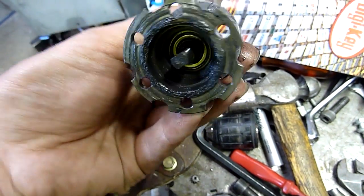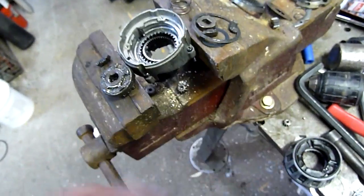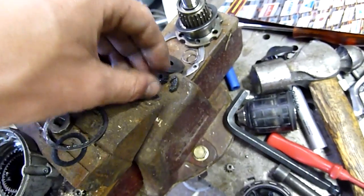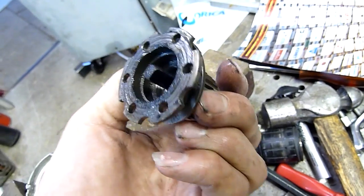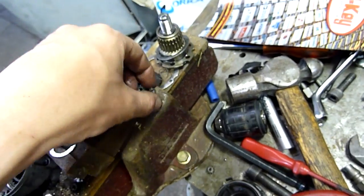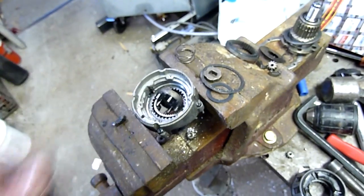You can see little friction surfaces inside there — I wonder if that's actually lock-up. I know what that is: that'll be lock-up for when you do the chuck up and try to turn it externally. The whole lot bites into the walls — these all get driven out and bite into the walls of this sleeve here, this bearing housing. That's how you can do the chuck up one-handed. You don't have a separate collar to hold on to and tighten it. So those serrations are what lock it up when you grab the chuck and twist it to tighten on the drill bit or the driver bit.